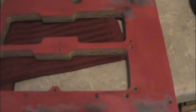So this stuff is dried and sanded. It cured pretty fast. But you can still see it's not perfect. And I didn't expect it to be since the stuff is 100 years old. So that's why we have this. Glazing and spot putty. I could put another coat of fiberglass on this, but this spot putty is actually pretty good stuff. It will actually help smoothen that up. So all you do is apply it, smoothen it with a trowel or something, or a knife, and it fills in those little craters.